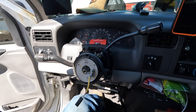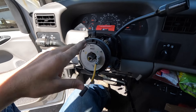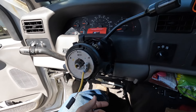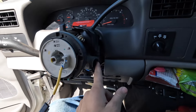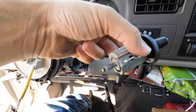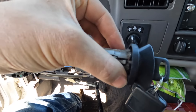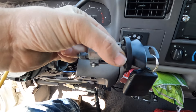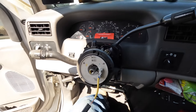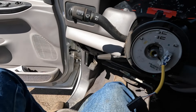Quick update — it's pretty far disassembled at this point. Got the steering wheel off, got the top and bottom covers off — pretty easy, just three screws on the bottom cover. To get the lock cylinder out, you put the key in, rotate it to the run position, push that little ball detent up on the bottom, and then the lock cylinder slides right out. You also need to remove the steering wheel adjuster knob — it just screws out counterclockwise.